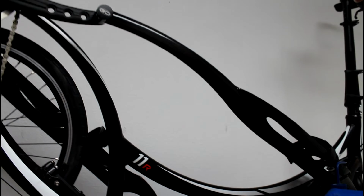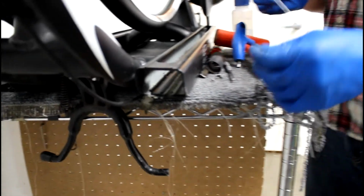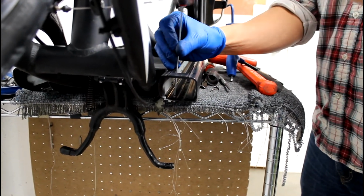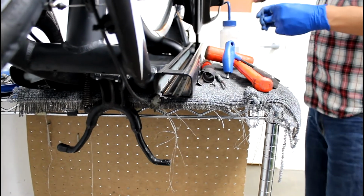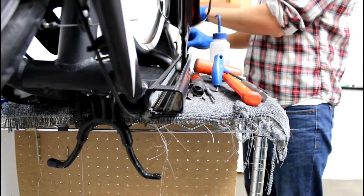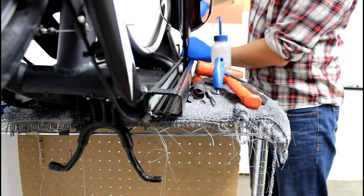And just reinstall your track insert screws. 2.5mm wrench. Helps if you start on the side of the track insert with the small hole on it, not the elongated oval. And you don't want to tighten them down until you make sure that both track inserts go in straight and flush.